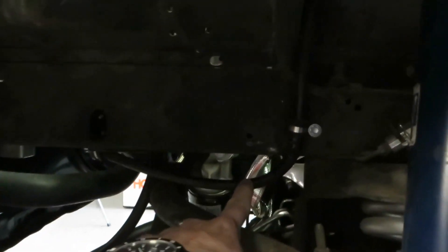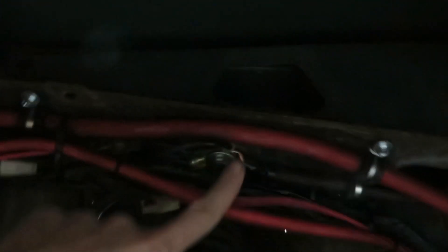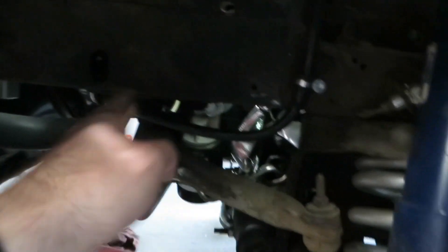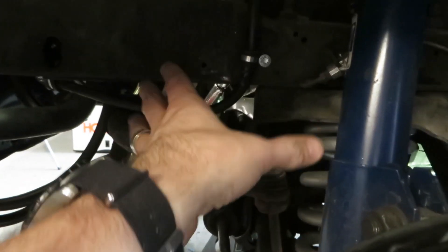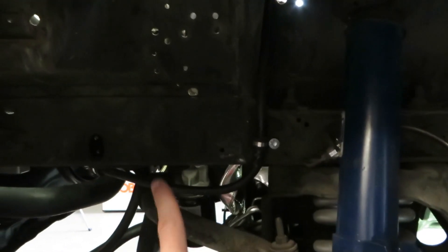You can see it going up through here now, along with the activator wire that hugs the groove inside the K-member and is zip tied nice and neat, up and out of the way. That removed the starter cable so it's no longer in the way. I've also got a ground cable — since I do have a wire tuck, the ground cable goes to a stud bolted on the inner fender, and a full-size cable goes all the way back to another ground in the trunk and then to the battery.